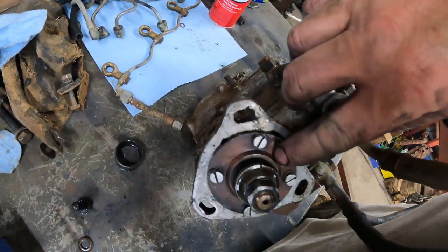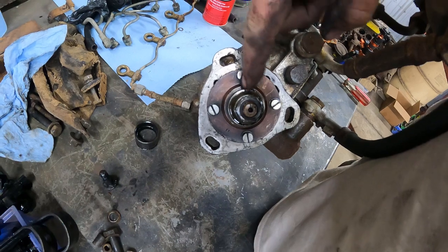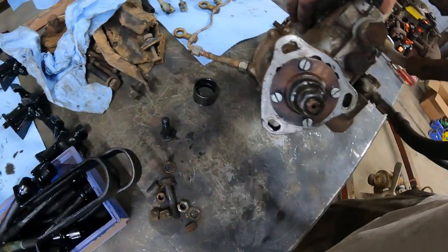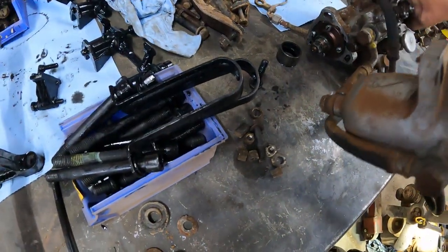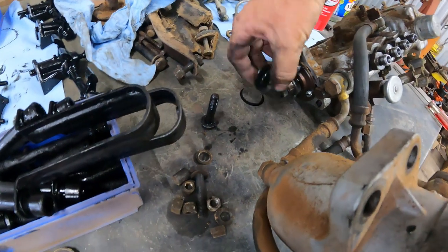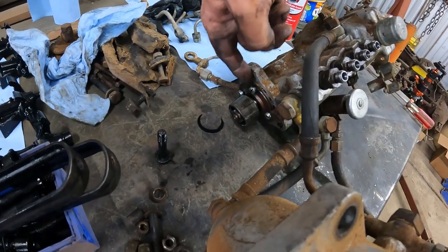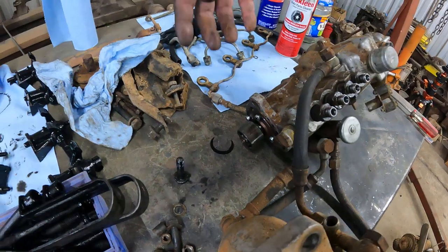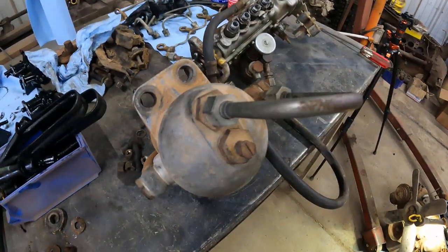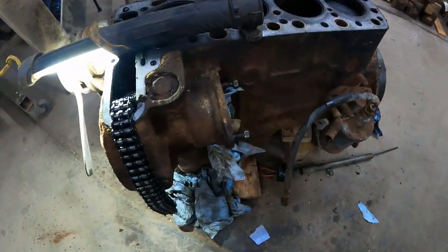On this pump it's really hard to see, but you have a mark also on the pump housing, so you want to align this with the mark on the housing, and then have the engine set at 45 before top dead center, and that's where you put the pump in. While you slide it in, you have a little wiggle room because of this ring of teeth. You want to have your screws centered, so that you have equal room to move for the final timing. But this is your preset to install the pump.